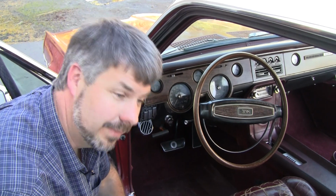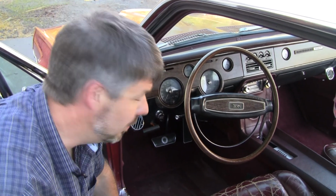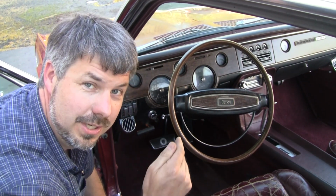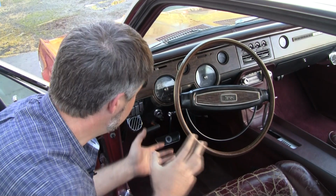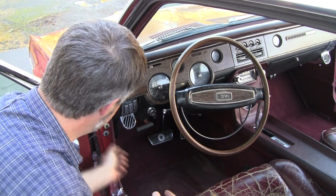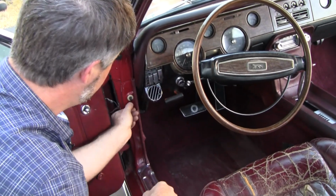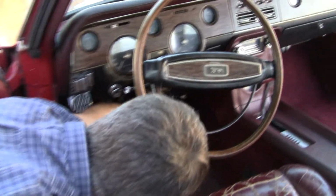We've got a guy here that full-time rebuilds columns for people. Keep that in mind, Mustang, Cougar, and T-Bird owners. But you need to have all the equipment. And a lot of times on junkyard tilt columns, people don't realize that they tilt away, so they just grab the tilt column and split. They don't take all the wiring that feeds through the dash. They don't take this vacuum component here.